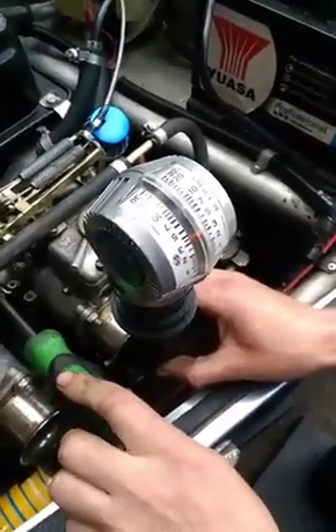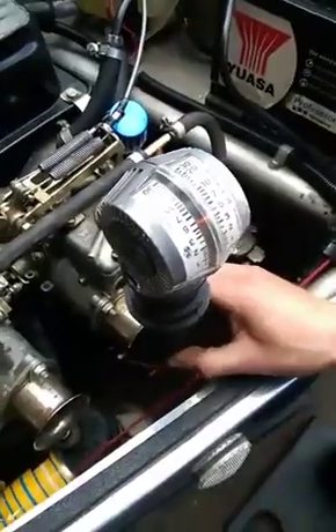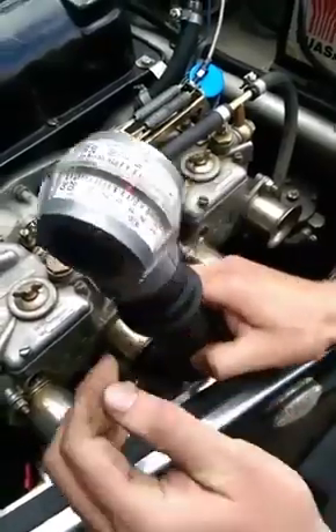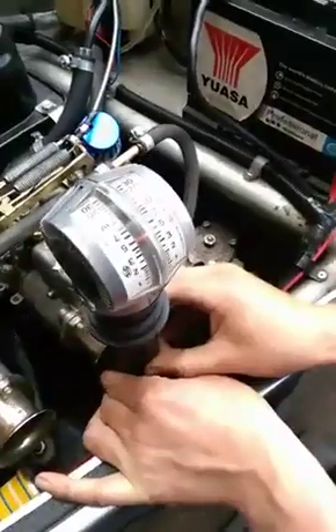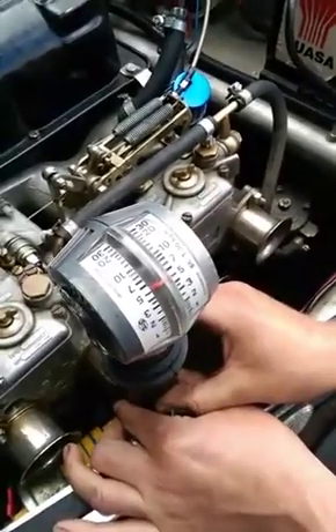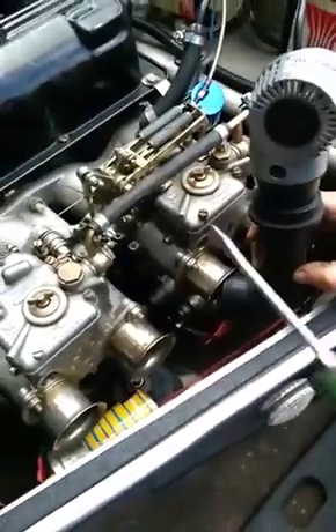You can see now we're starting to raise the air. Probably just bring a little bit more throttle on. We're now at five, so now you check that compared to the original carb which is just over five. Give it a little rev — just clear everything. Already it sounds better, that's picking up a lot quicker. Nearing dead on five.